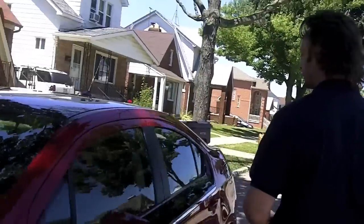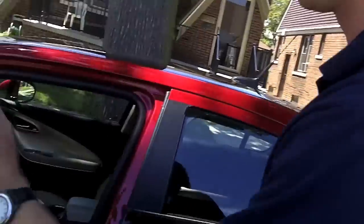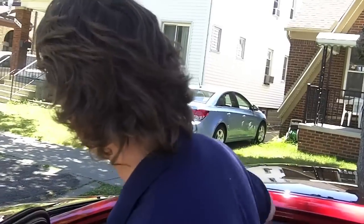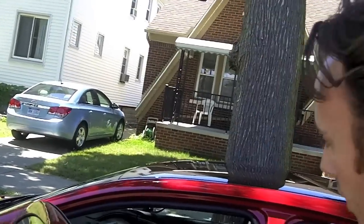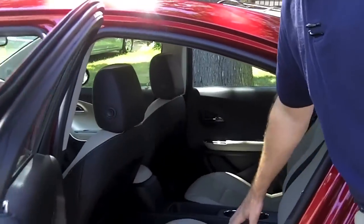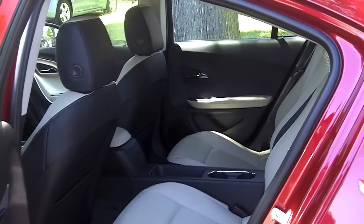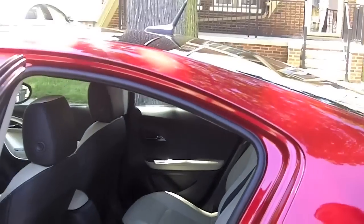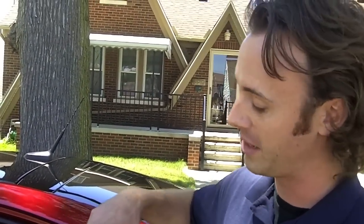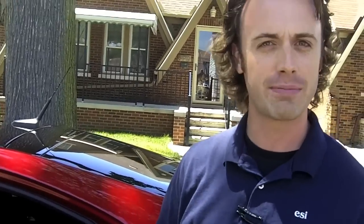The reason I open up the car to talk about all-electric mode is to signify the path of the battery. We have this very large lithium-ion battery pack that starts up at the bulkhead, travels through the central portion of the vehicle, ends back here, and then splits underneath the rear seats. It's a six-foot-long T-shaped battery cell composed of 288 individual prismatic cells, each about the size of a five-by-seven picture frame, all working as building blocks.